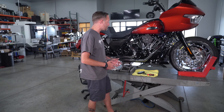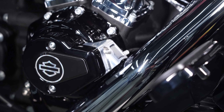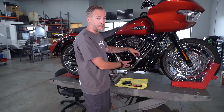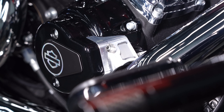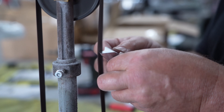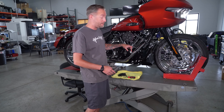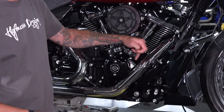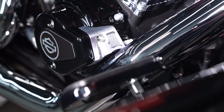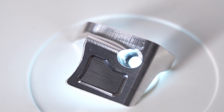Following in those footsteps, we came out with a front sensor cover for the new cam cover and the new sensor. You had that big bulky plastic piece, and in the past few months since the bikes were released, everyone's been trimming them out. What we did is machine a replacement piece — a nice CNC in-house billet aluminum piece that utilizes the stock bolt and is a perfect fit to your stock outer cover. So this option lets you retain your stock cover with our replacement for the factory piece.